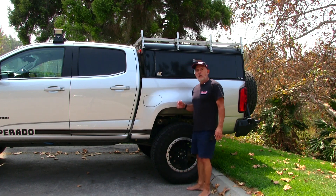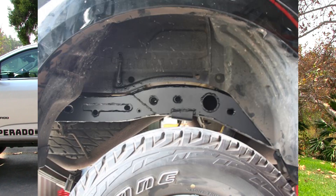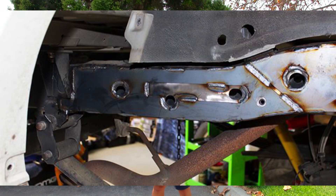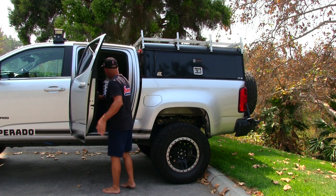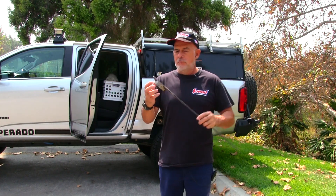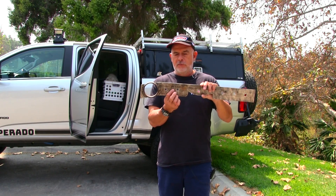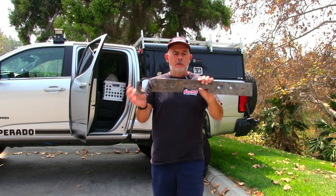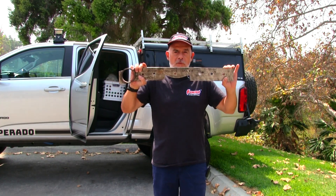I'm not reinventing the wheel here — this has been done before, just not Colorado-specific. So I figured I'd make my own. I made my own plates. Here's my first prototype — this is the crossmember reinforced, and the area of bending was right around here where the frame kinks like a banana. I probably didn't have to make it this long, but I figured let's spread that load out through the frame.